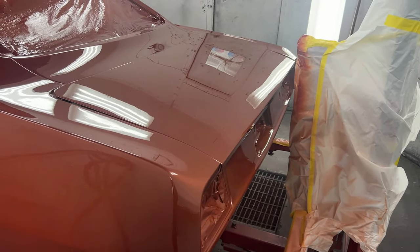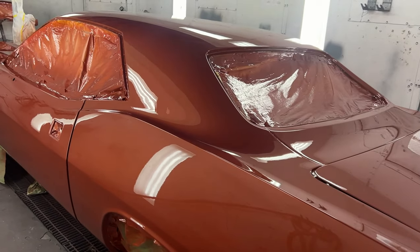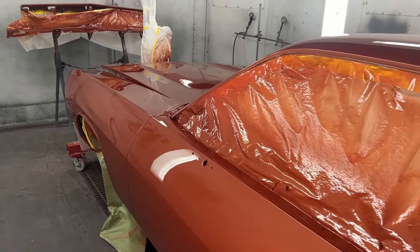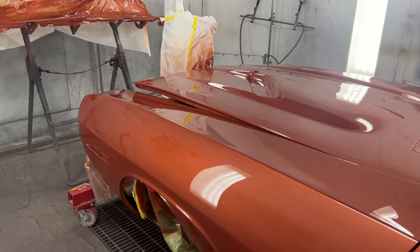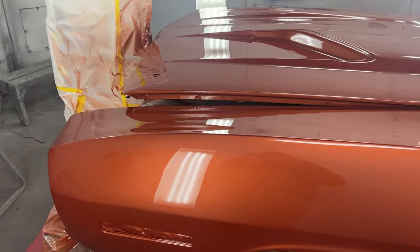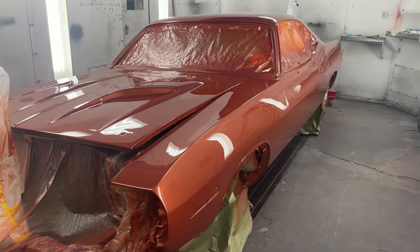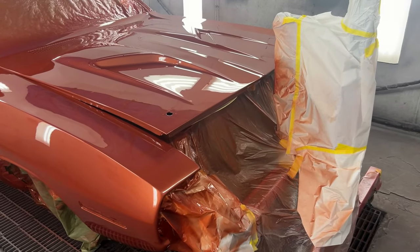So then the final two coats are done the next day. The car is rubbed with 600 grit paper and then two coats of clear applied. So here is the car completely finished with all of its clear on it. And now the next video that I will post will be of us cutting and polishing the car, which means that it has to be wet sanded down and then polished to get rid of all the imperfections and smooth out the clear. At that point, the car will be like glass.